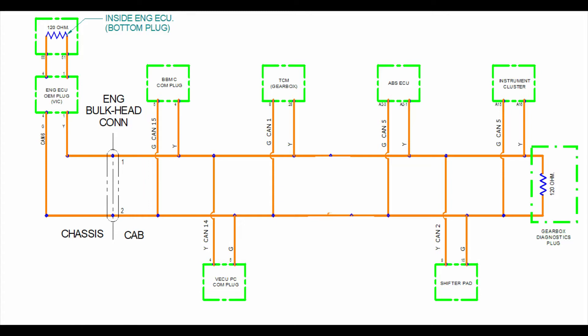CAN bus, or Controller Area Network, is a two-wire communication system, and it's a way of allowing multiple ECUs to communicate, send information such as sensor inputs or outputs over these two wires. It basically cuts down the need for individual wires for each sensor or output solenoid from each module. The way that they do this is they essentially transmit voltage pulses down onto each line, and that message or voltage pulse is then picked up by every other module that's physically on the network.